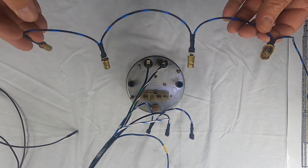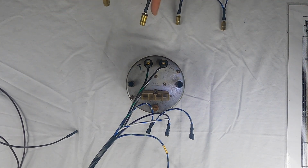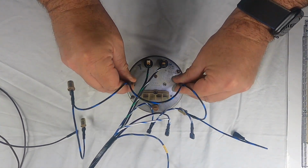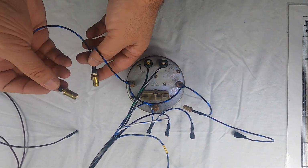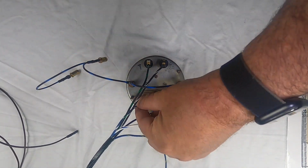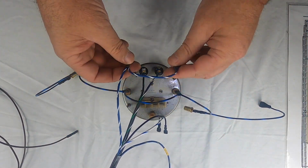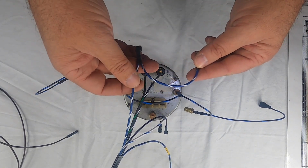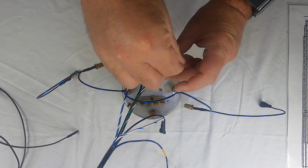Then I'm going to go ahead and bring in my dash bulbs. So we're going to hook that up, and it's going to get these 2. The other 2 over here went to the other gauge, to the speedometer, and then this one will go to your combo gauge. But it gets 2. Then we have the hazard signal, right? So it goes to the 2 turn signals, so when you turn your hazard lights on, they both flash. So it's a blue with a white, and it goes to the other spade on the 2 turn signals, like so.